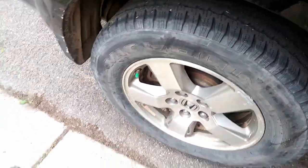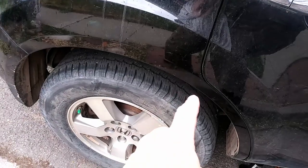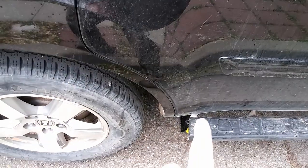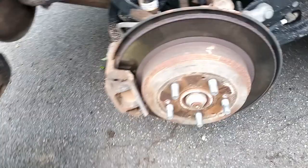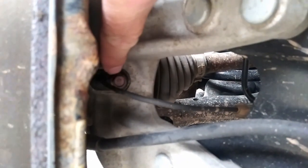Now, it's possible you could do this from underneath the car — definitely would be easy if you had it jacked up or on a lift. I'm going to pull this wheel off, then jack it up, and hopefully just be able to have enough access. I'm going to put a jack stand under there just in case the jack fails — I always like to feel confident the car is not going to come down on me. Now that I got the tire off, you can see here is where the wheel speed sensor goes into the hub, and here's a better shot of where I think the fray causing my problem is.